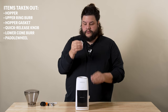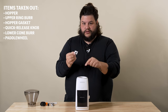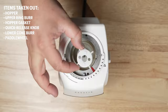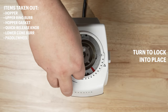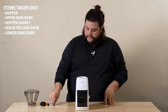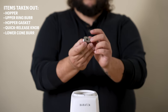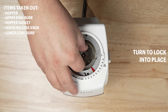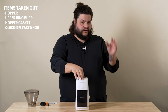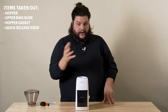Next is our paddle wheel. The paddle wheel has two little cutouts and those key right into the top of the drive shim on those two little knobs. The drive shim also has knobs that will go for the cone burr. Drop those in, and I like to turn it to kind of lock it into place until it doesn't move side to side. Next is the cone burr — two little knobs there that go over to the posts on the paddle wheel. Drop it in and turn it until it clips into place. Make sure it's fully seated; you don't want to add your knob to the top without it being fully seated, as that might cause grind issues.